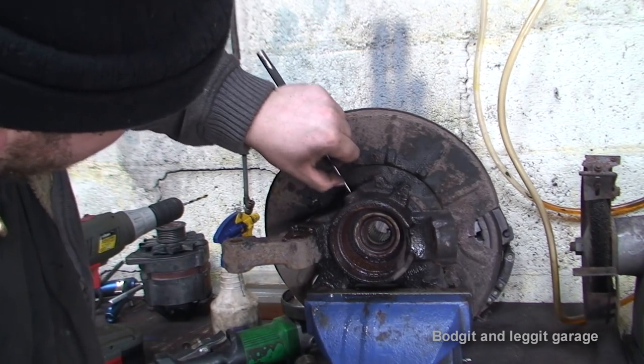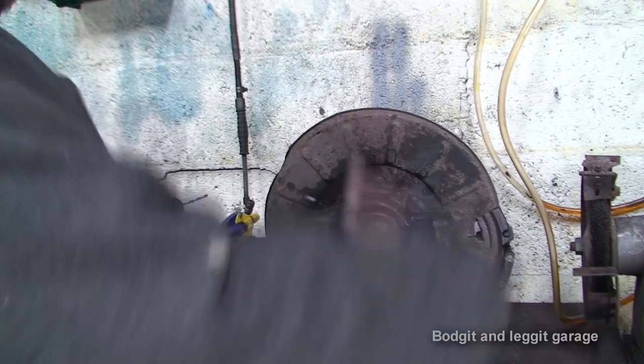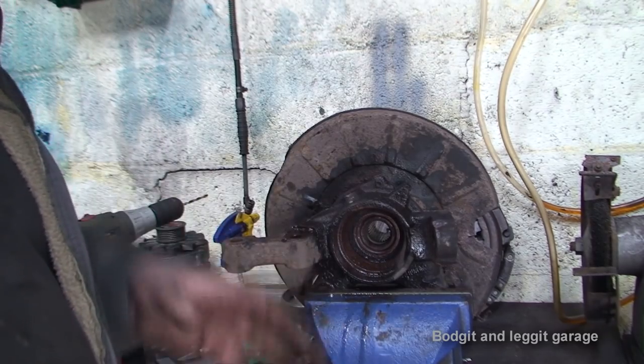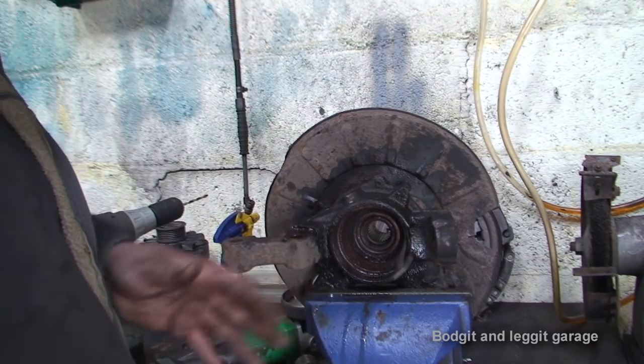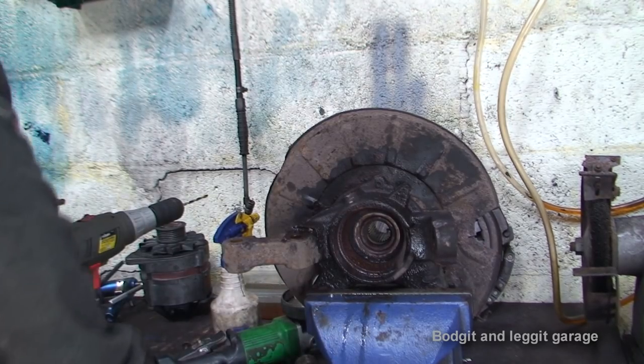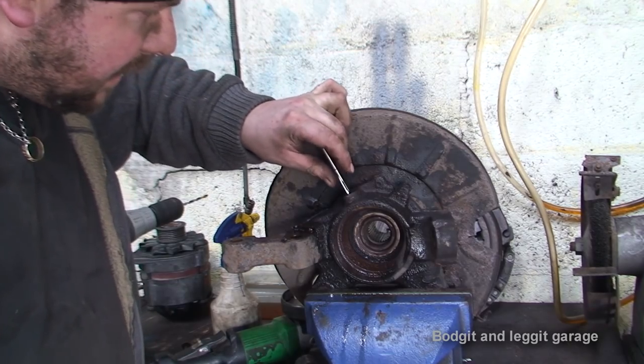How deep my hole is. Now you can see that's how deep it is. That's going to be plenty for an ABS sensor. You know, we don't need it. It's not really holding anything, it's just holding the ABS sensor in place. It's under no stress. So, now what I need to do is get my tap and then start actually tapping